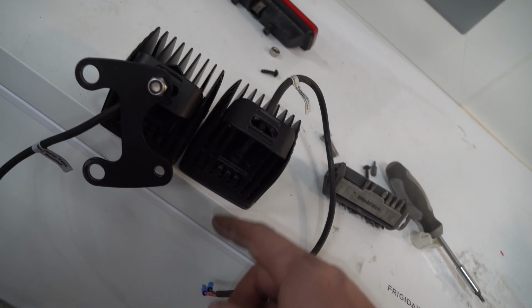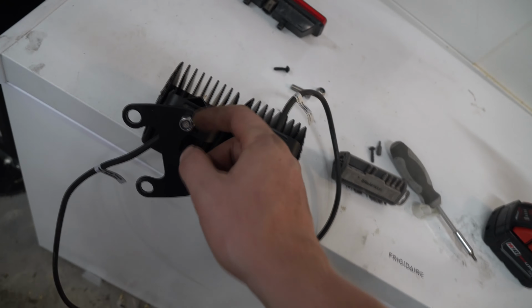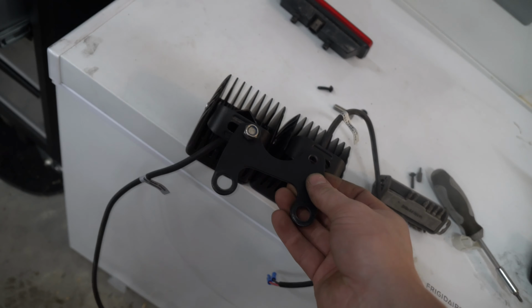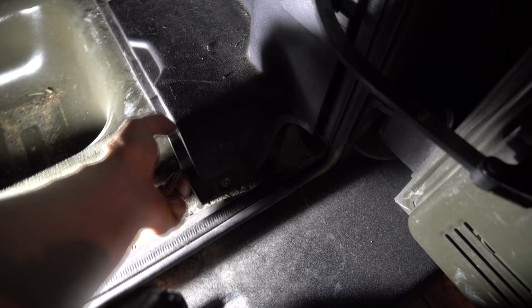On this bracket, if you want to do this, if you have these bolts with the nylocks, you're going to have to step it up a bit. Step the hole up just a tiny bit so it has enough room for that screw to come through. And then now we'll just mount these two just like that and see what kind of movement we have there. Pull these two bolts out that have little hangers on them. They're just a Torx bolt. You'll see now that you can get in here so you can run your cabling up this piece of plastic to the back.